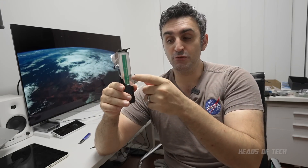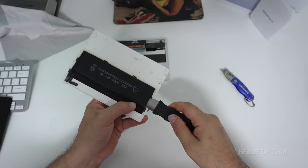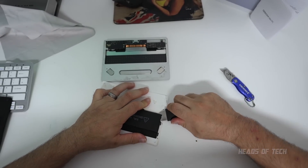There's lots of glue everywhere, all over the back as you can see. As I was using the prying tool, some gases got released and the battery kind of flattened down — it was no longer swollen and I could actually fit it all back in and everything worked as normal. But I read up and lithium-ion batteries, when you damage the casing, are not safe — doubly not safe. Also, be careful buying used lithium-ion battery goods off eBay. I could have easily just plugged the battery back in and sold it, and someone would have had that fire hazard in their house.